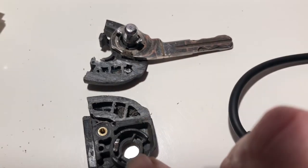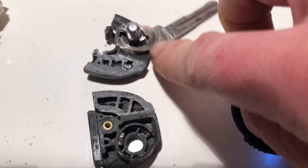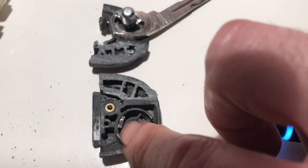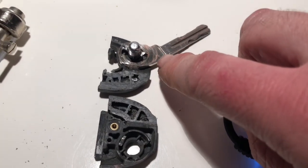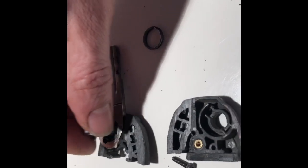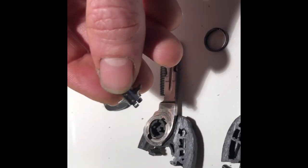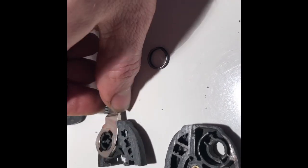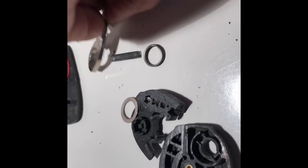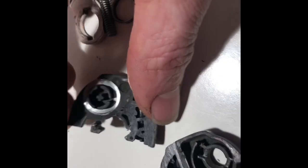The key comes off, and the piece that people say breaks is totally correct — you can see that most of the piece is there, but there's a piece left over in the other part of the remote. That is the bit you need to replace to fix the fob, assuming your problem was the same as mine. With the piece taken off, this piece comes out and you'll notice the spring fits into an indentation inside that piece. Clearly the piece is broken. The key comes right off, and there's a washer underneath the key that fits over the circular piece.